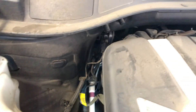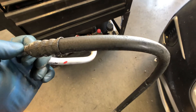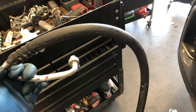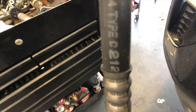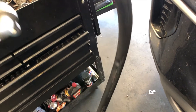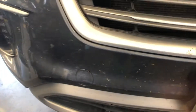If you had a leak on one of those hoses or anywhere else, it would look something like this — this came out of a Kia Optima I just did. You can see how it looks when a hose is leaking. If you look at this fitting, you can see a little bit of seepage — that's a common leak on these crimps. This one is pretty bad, but it came from another car. What I actually found on this car is something else.